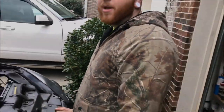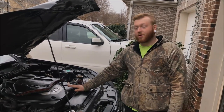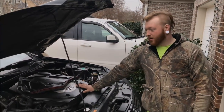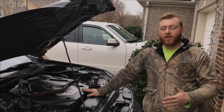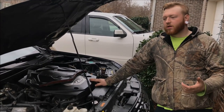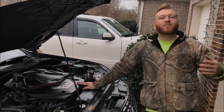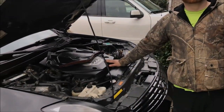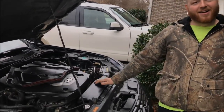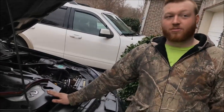In these cars, I would recommend getting an oil catch can — they do consume oil like hell. If you have one, make sure you check the oil every week because these will run oil consumption down to the ground. This car drinks about a quart every two weeks. You can get full synthetic or synthetic blend — 10W30 or 10W40. I'd recommend 10W30; it's thicker than the standard 5W that normally comes in the car. If you want to go the 10W40 route, you might have to check the gaskets to make sure nothing leaks.